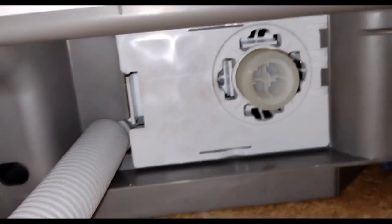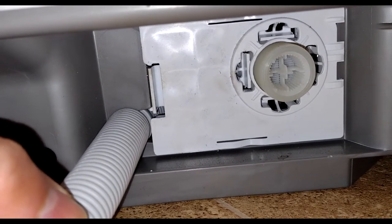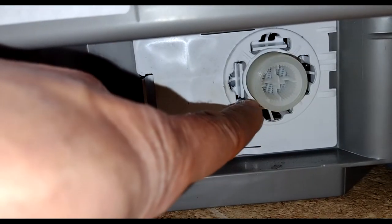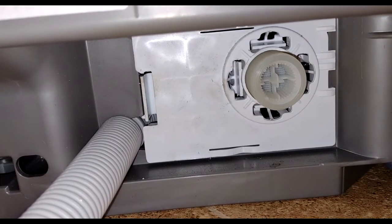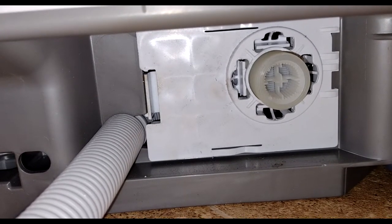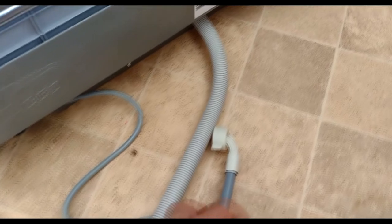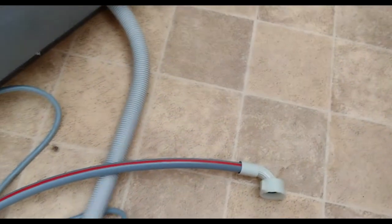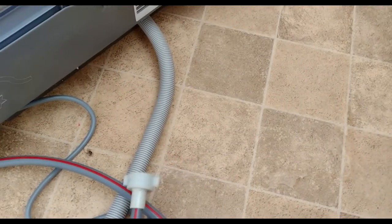Right next to the exhaust where it comes out from the machine at the back low end is the place where you fit the inlet pipe - the angled section of the inlet pipe goes here. Something to note: it should not require a tool like a plier; it should be hand-tightened, fully tightened but hand-tightened. Also remember there are seals inside both ends of the pipe - just before you fit it, ensure the seals are there otherwise it will leak.